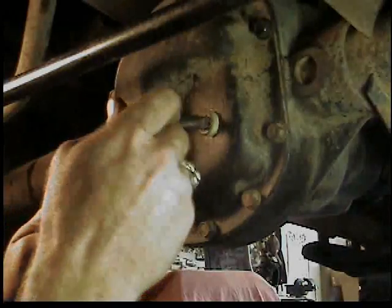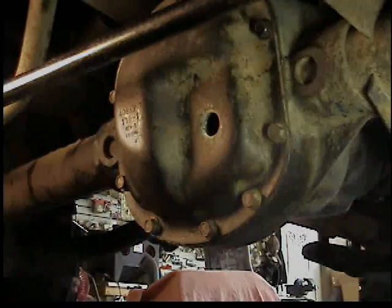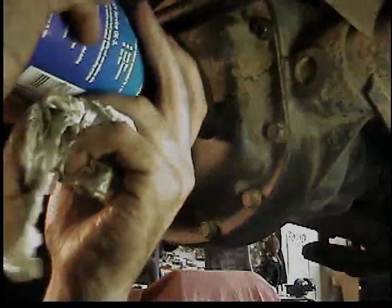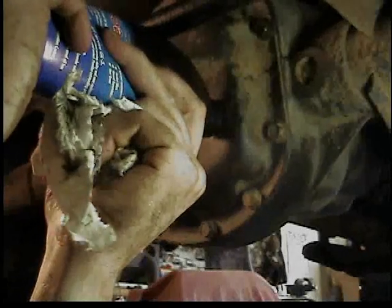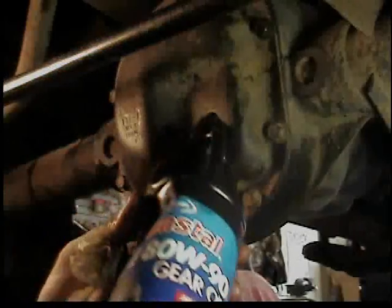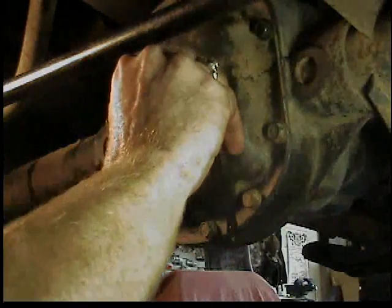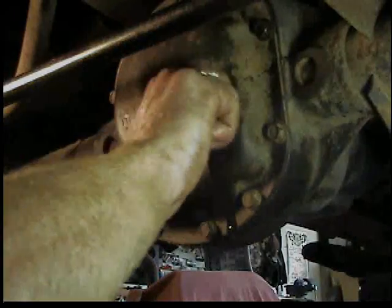Go over to the other side and fill it up with lube. Take the plug out — it'll take about a bottle and a half of gear lube. The book says 80W90. Just go until it starts running out, then wait until it stops dripping. Put the plug back in, wipe it off, and you are done.